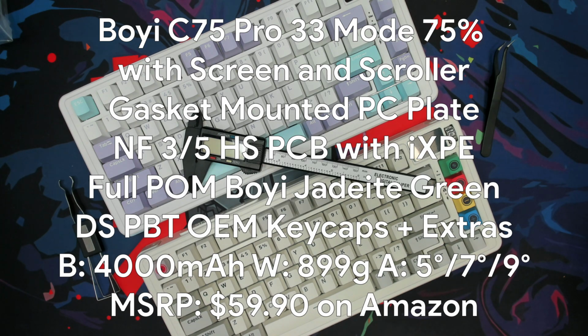It has a battery capacity of 4,000 milliamp hours and comes weighing in at 899 grams and does not include a physical OS switch. The chin of this keyboard sits at 22 millimeters above the typing surface, while the back sits at 28.5 millimeters, providing for a default typing angle of 5 degrees. Flipping out the first set of fold-down feet will take the back height to 33 millimeters and change your angle of typing to 7 degrees. Flipping out the final set of fold-down feet will raise the back up to 39 millimeters and change your angle of typing to 9 degrees.